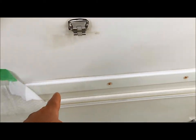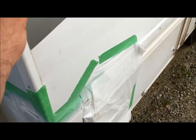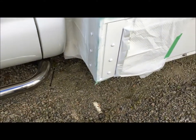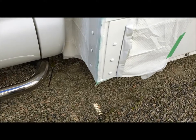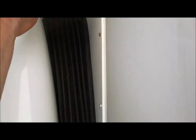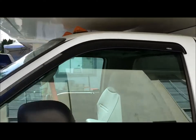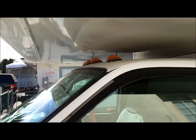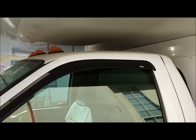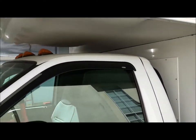What I ended up doing was modifying it to put lag bolts in here. There's actually an angle iron channel in here, so we went through that angle iron and bolted plates on both sides. My wife just got home from work — she prepped and painted it, so that's her work there. We'll silicone and caulk it really well after. As you can see, this part here was actually down to here — now it's nice and level, body lines are identical to factory, and clearance is really good. We put brackets on both sides so it's solid and drives really nice.